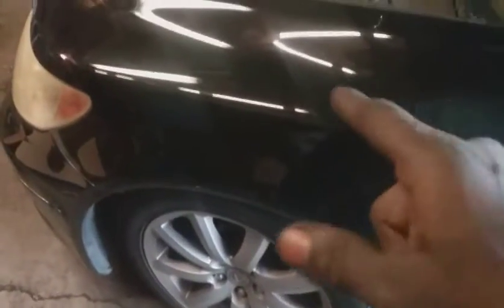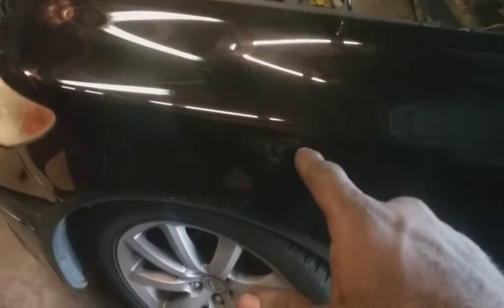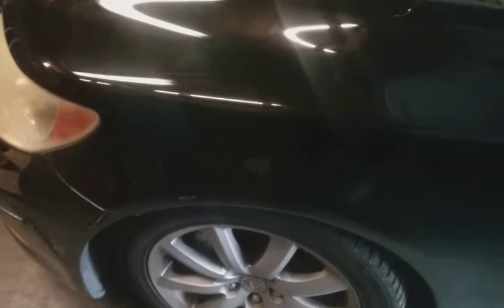I think that's the level sensor. They had 10mm bolts, and I just took another 10 to the ABS sensor hanging on to the strut there. And of course the 14 to get the upper strut mounts off. Other than that, if anything changes from what I did a little while ago, I'll update.